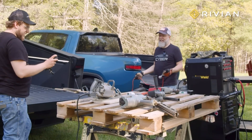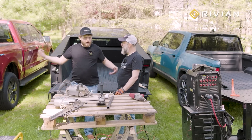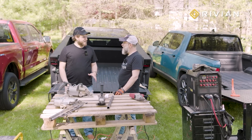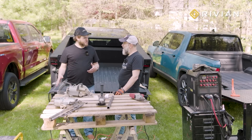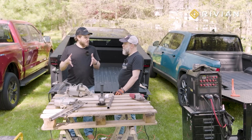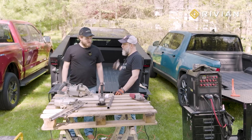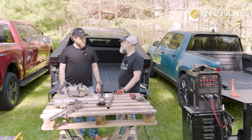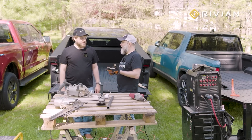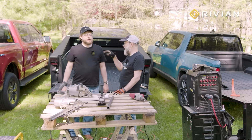It's not enough juice. I just didn't like how it treated the power tools — like, what if you had something that drew a lot of current and then also a computer, which would not like that voltage sag. That Rivian setup is really more of a campsite solution. Although honestly, you might bring a microwave, a blender, or a heater to a campsite, and those draw a lot of current too. That's 15 amps for you; the Ford and Cybertruck are both 20.